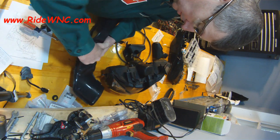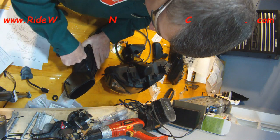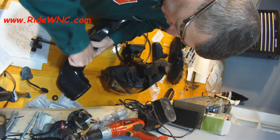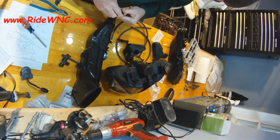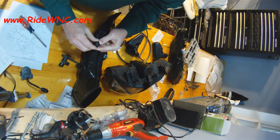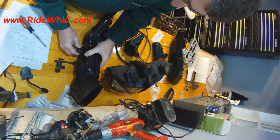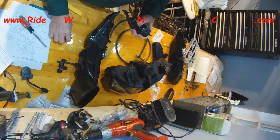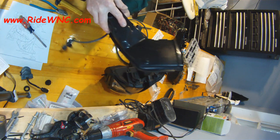The OEM grommet just fits into place, going into the ram air snugly — far better than the hard plastic piece that came with the eBay kit. So if you're replacing your ram air, go to Bike Bandit or another parts house and get the OEM piece. The eBay version has no hole on top, and that hard plastic would never fit into that hole. Plastic and rubber are just two different compounds — whoever designed it was clueless.